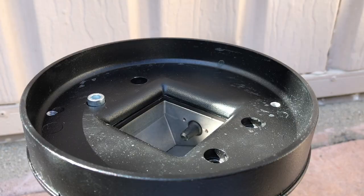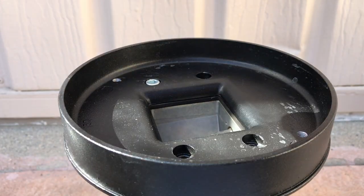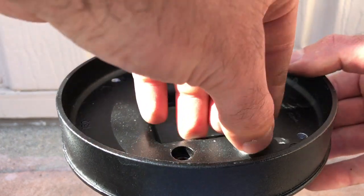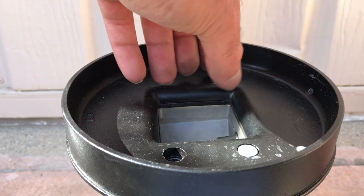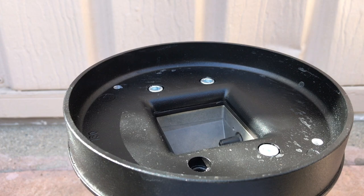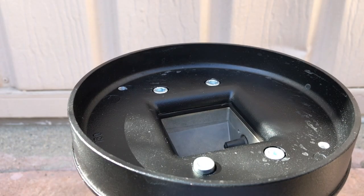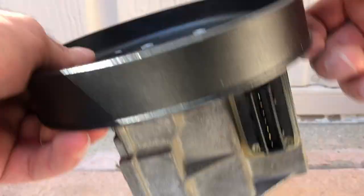This is probably the easiest install I've done on the car — knock on wood before the car catches on fire. As per the instructions, I've added some thread locker to these allen bolts. The reason they suggest this is because you're not supposed to over-torque these, so I've tightened them just enough and the thread locker will ensure the bolts don't move out of place and get sucked into the engine. They don't include the thread locking compound in the kit itself, so I'll have links to all the tools and parts I've used in the description box below.